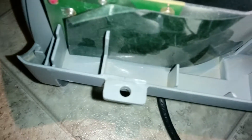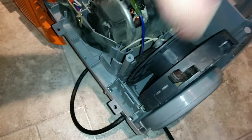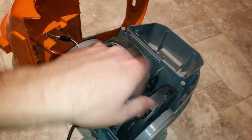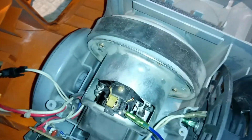I may have broken off another clip — but no, that's the only one you have to worry about. Five screws and that tab pushed in gets you into the chassis. Once you're in, the cord wraps around here — just rotate it until it pulls out, unravel it, pull it out, and then you can fix it and put it back together.